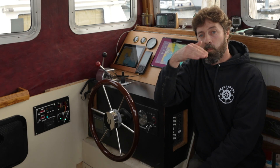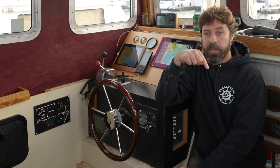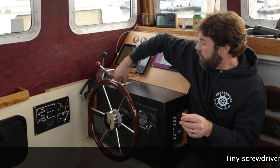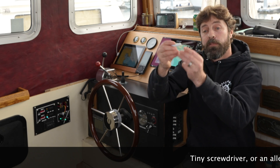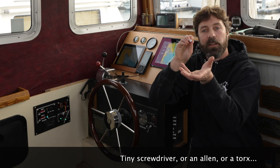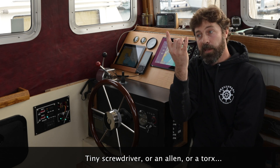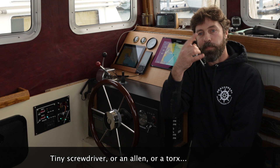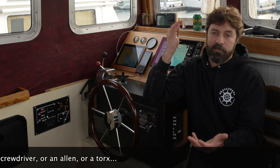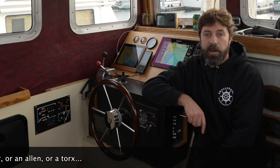We're going to figure out what RPM we're at in reality. Then we're going to look at our tachometer and pull it out. And using a little tiny flathead screwdriver, we're just going to adjust the little dial on the back of it, and that's going to bring us to where we need to be. It's a really simple process that takes very little in the way of tools, but it's important.